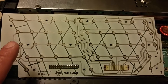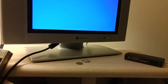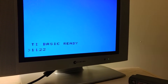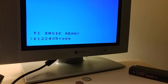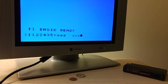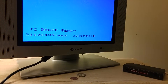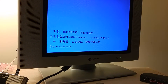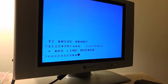I pulled everything back — there are no keys on it yet — and I'm going to press across the top row here. Going into basic: number one works, number two, four, three, five. You can see I'm pressing all on the Mylar now and I'm getting my keys. My guess was that there wasn't a break, but the Mylar was simply sitting for so long — maybe in a heated attic — and it just fused itself together. Pulling it apart seems to have fixed it.